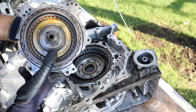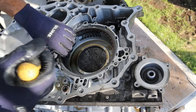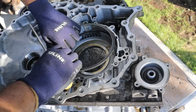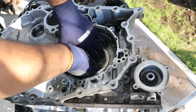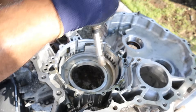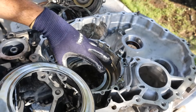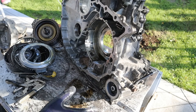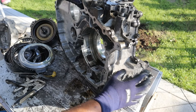In order to make the CVT spin backwards and forwards there is a clutch system inside here with a planetary gear set. We've got one set of clutches inside here controlled through the input shaft, and there's another set of clutches that can come out — the clutches look like they're in pretty decent shape actually. There's also a return spring and a piston. The rest of the casing holds everything together but is also a hydraulic pathway — the filter sits inside here, fluid goes out to the radiator and back, and passages here control the clutches and variators.